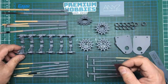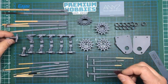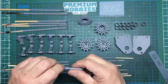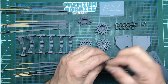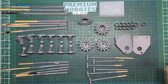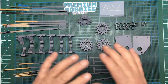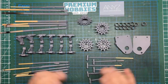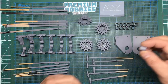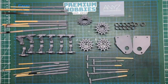We can just de-nib those going over them, going around in circles and just lightly de-nibbing. You don't need to make too much fuss about this — it's just a case of getting rid of any dry patches of paint, because if you have got a dry area with overspray it may not be stuck down properly and the top coat can come off. Good painting is all about 95% preparation, in my opinion. I'll go on and rub all these down and then come back for some painting.